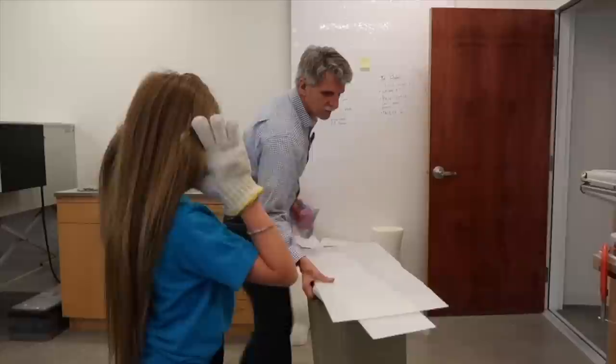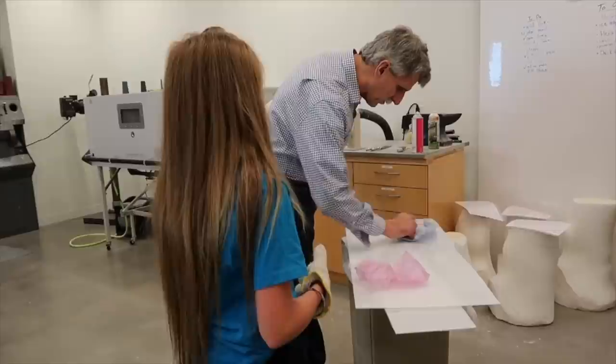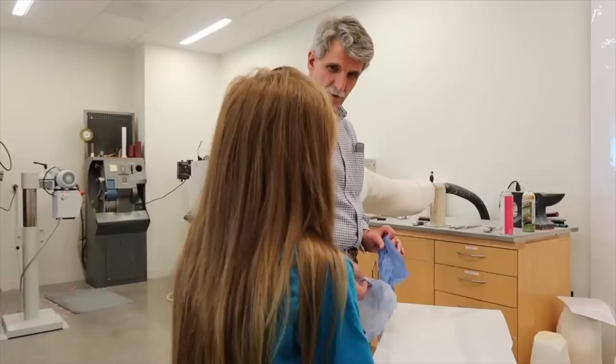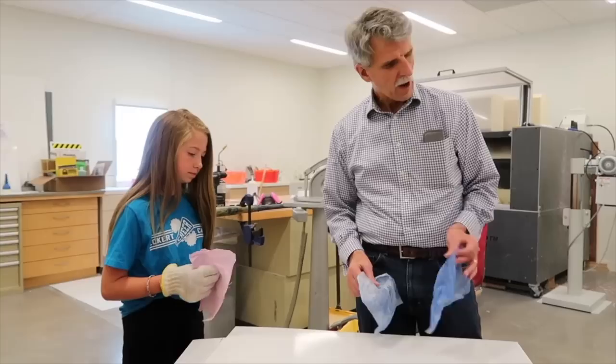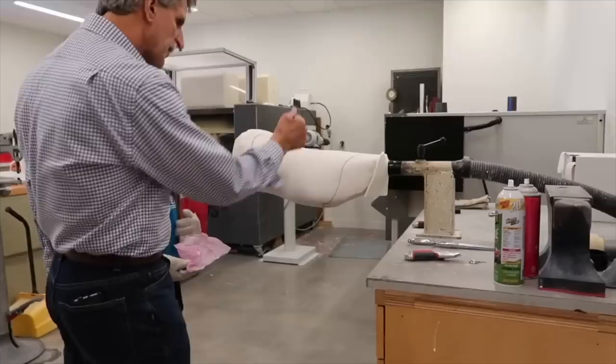When the plastic comes out it's actually clear and hot. What we're gonna do is dab and roll, and move it around — the longer it stays, the darker the color. Do you want a lot of color, pink and blue, or a little bit? Most clothes you wear, you won't notice it underneath unless you're wearing something white and tight. We'll dab and roll it all around the plastic, shut it back in, let it warm up, and then pull it around your shape. Once I get it on there it starts to cool off pretty quickly, that's where I'll cut it off around the trim lines.